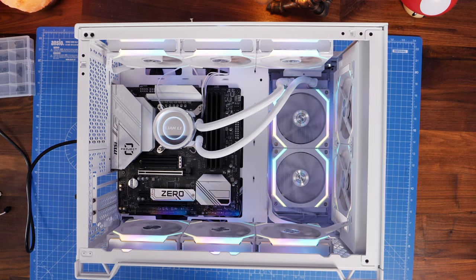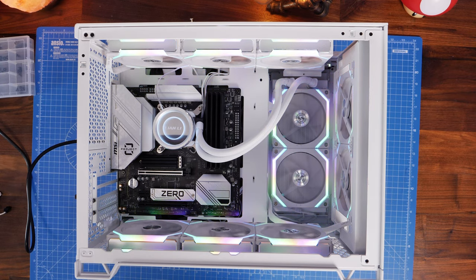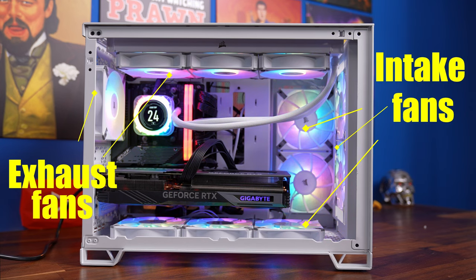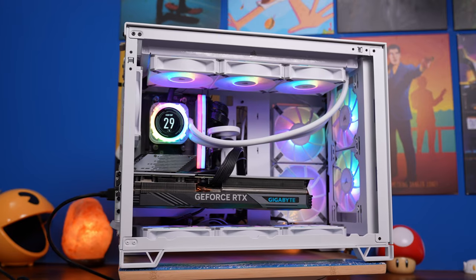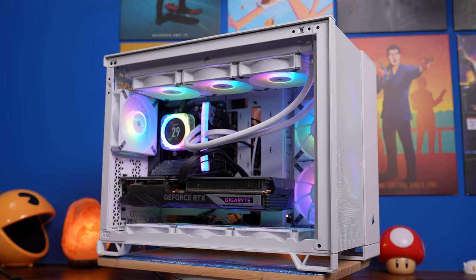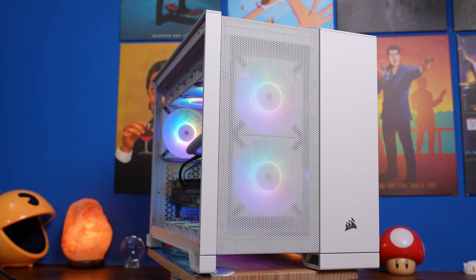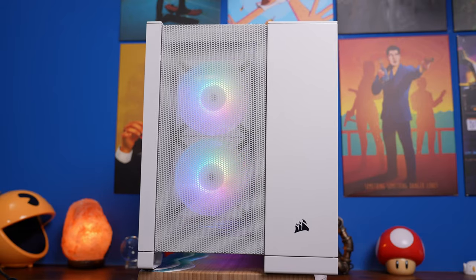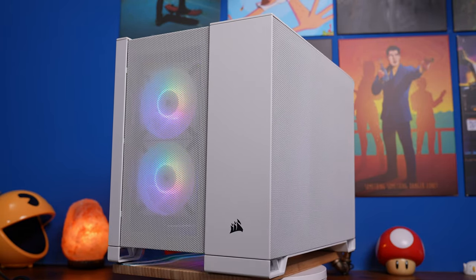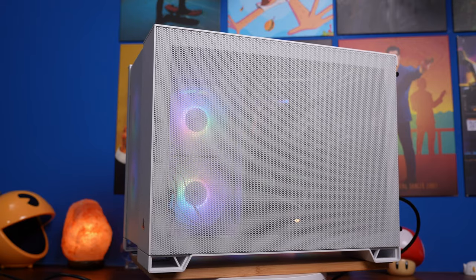There are lots of different potential build options with different fans, so I want to talk about orientation and logic. With Corsair's setup I'm using AF120 RGB Elite fans: front, side, and bottom fans all set to intake, then exhaust fans on a 360mm radiator on top and one exhaust fan on the left-hand side. For intake fans you need to see the back of the fans for airflow direction - that pulls cold air through from the front, bottom, and side onto the graphics card, then up through the radiator and out. The RGB fans also look great visible from multiple angles through the air panels.